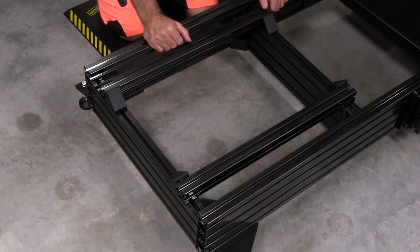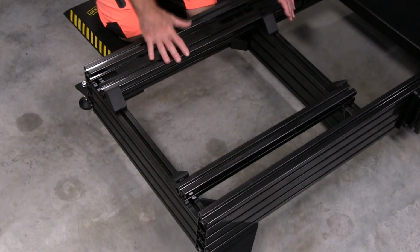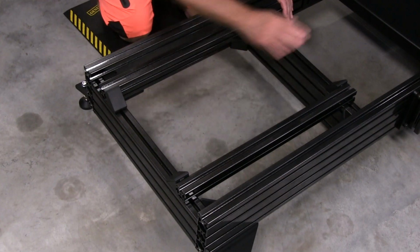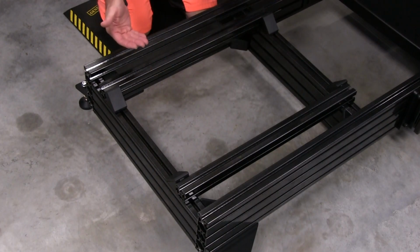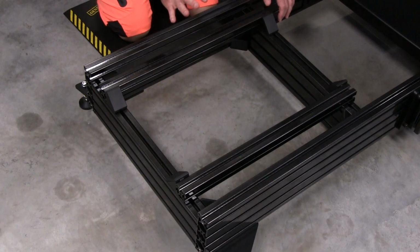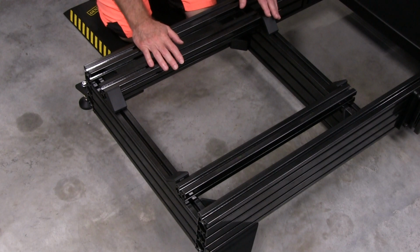I'll tell you why. Before, we had the rails sitting on top. In fact, on most cockpits that we build these days, the heavy-duty premium ones that have like a 40 series, it has a 4160 on it, it'll still have a 4160 here and here, which is great for structural integrity, but it does kick up your seat rails, and that makes the seat higher. And to me, I want the seat to be able to sit as low in the cockpit without suffering any problems with structural integrity, so that I can get a good ergonomic seating position.